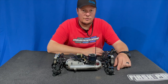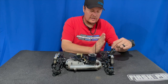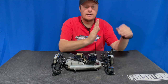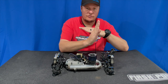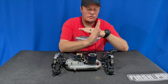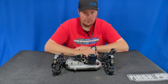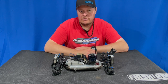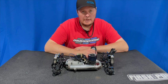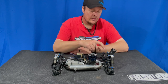The main reason for doing this is to help the car accelerate a little bit better through rough conditions. What it's doing is kicking the top of the shock back, essentially angling the shock slightly back. The shock is mounted to your suspension arm which is also slightly angled back because of the anti-squat, so as the arm is traveling through the throw going through bumps it just makes the suspension a little bit freer, less binding, and just overall a little bit better with more grip in rough conditions.